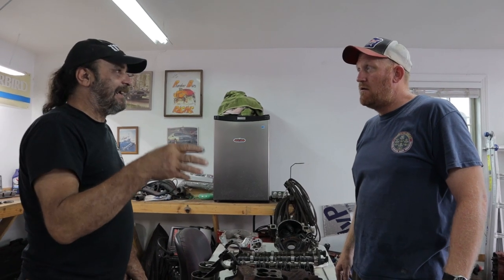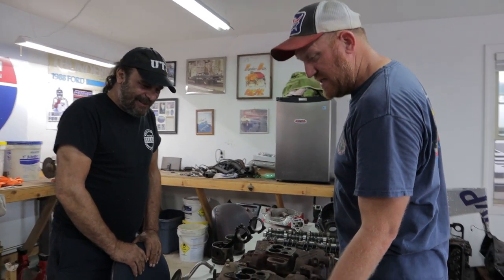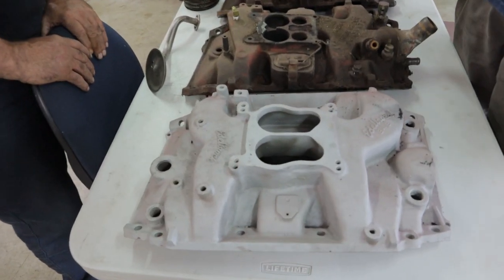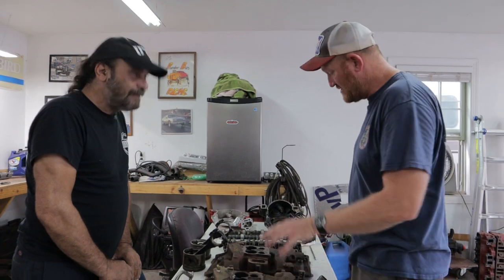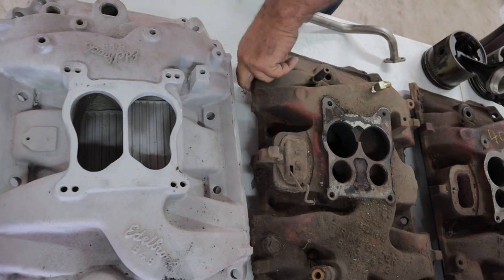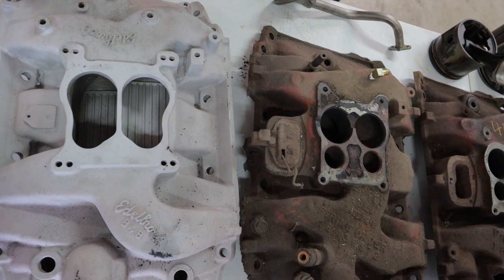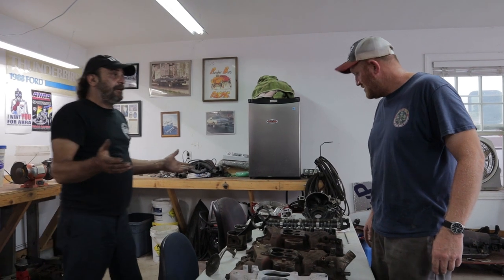We used to have a customer at my gas station on Staten Island in the '80s — we called him Fudd, like Elmer Fudd. He had a Riviera that was Stage 1 and it was brutal. This Edelbrock B4B piece my dad actually ordered from the dealership parts counter around 1977. Edelbrock re-pops these now, and a lot of people say there's no difference between this and a stock intake manifold, but if you look at the height — the plenum volume is so much greater, the runner size is increased, plus there's significant weight savings. You can pick this up with one hand; the stock manifold you need a team of people to lift.